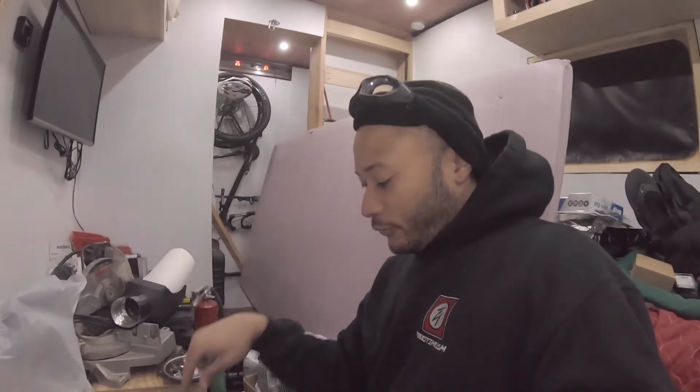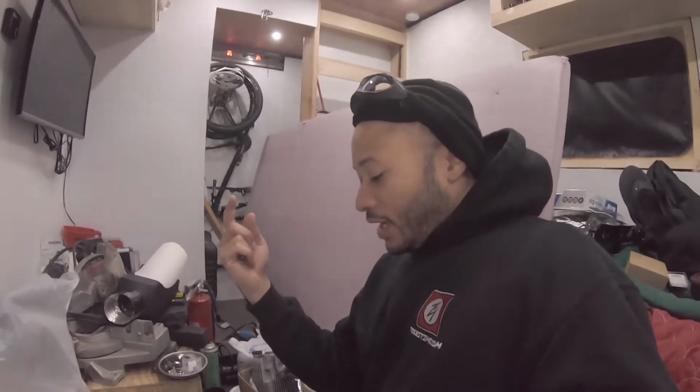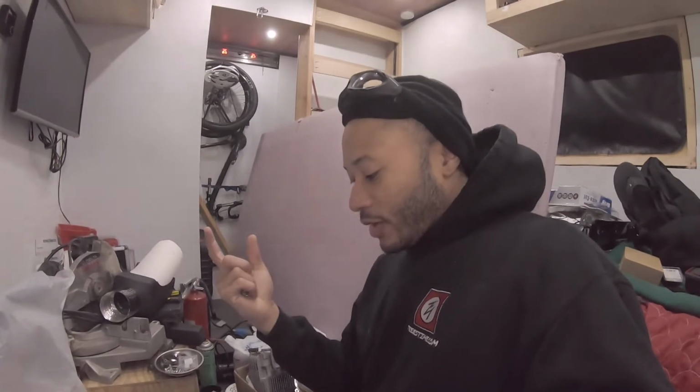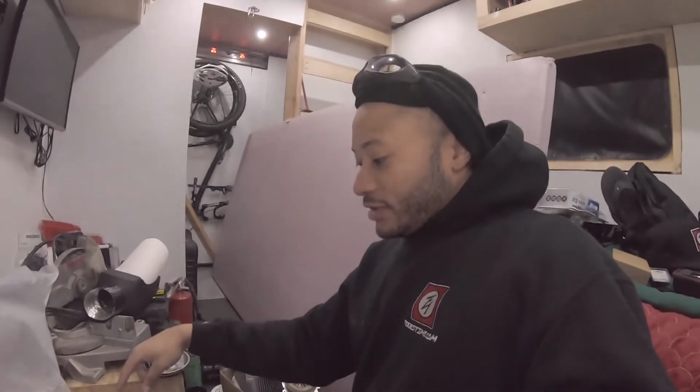The only issue I really saw when I was cleaning it was a soot buildup where the fuel feeds, so it just wasn't getting fuel to the fuel screen. It was filling the chamber up with diesel. So that's most likely why it wasn't working, but I went ahead and did a service on it. Went in, cleaned, checked everything, have new gaskets, new diesel, the little inline fuel filter is in there, and then we have a new glow pin. So everything should be good. It should be operational.